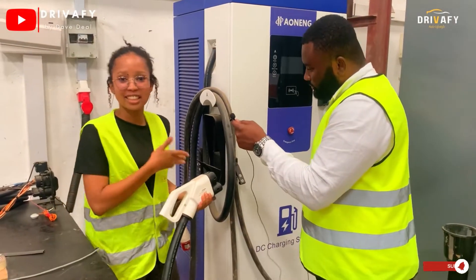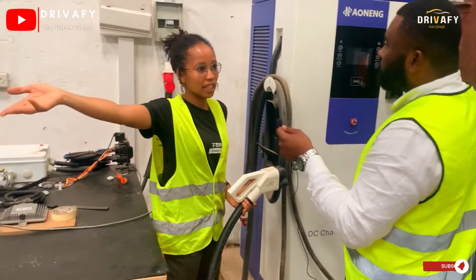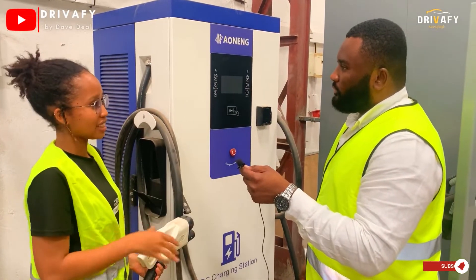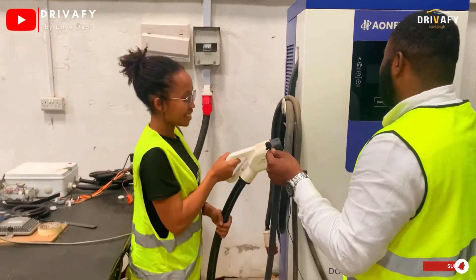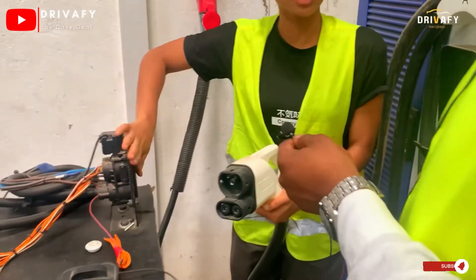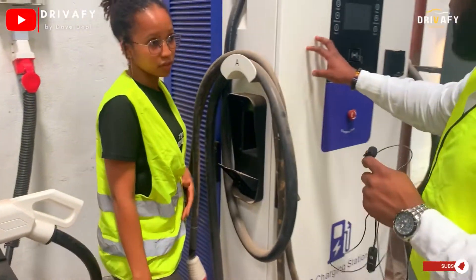What is this? This is the first charging station I mentioned — this one is quite powerful at 180 kilowatts. Our battery pack is 120 kilowatt hours, and this charger is 180 kilowatts, so 120 divided by 180 means this will charge the vehicle to full capacity in less than an hour. It looks quite like a fueling station. Yes — you just come and take this coupler and connect it to your vehicle, like this.